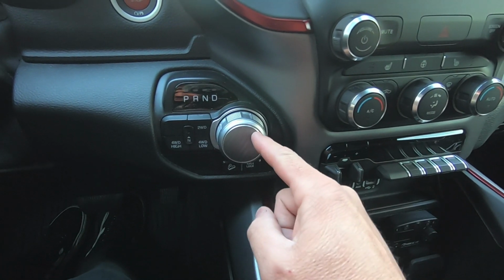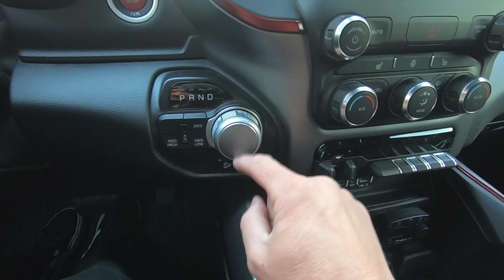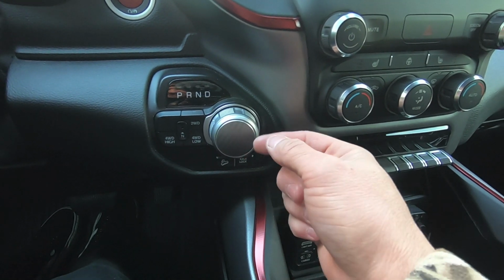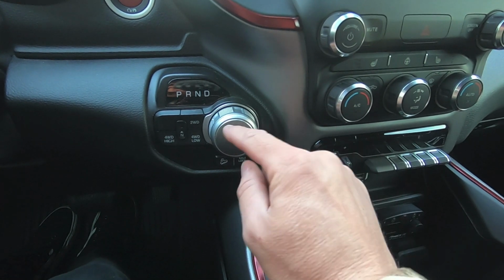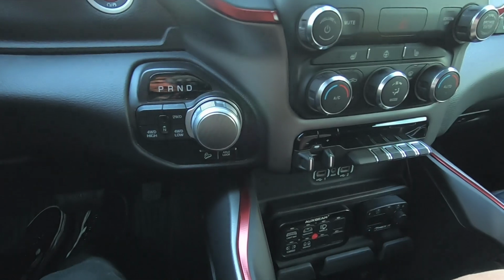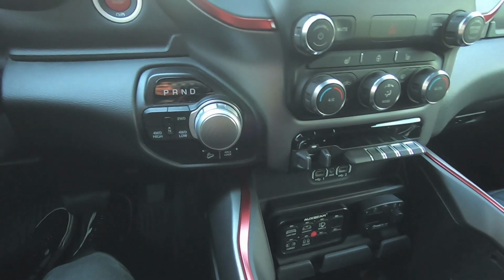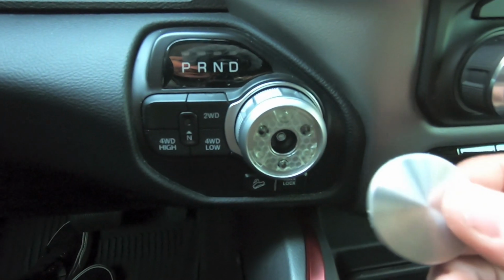The razor blade is used to pop in between the knob itself and the center cap, and then we're going to pull it off. There's a little bit of adhesive behind this, so it might fight with you for a little bit, but once you get it off, that will reveal the 3 screws that we're going to undo. Then it's as simple as popping this off, putting our new AJT knob on, and finishing up the process. Alright, so we have the center cap completely removed here.